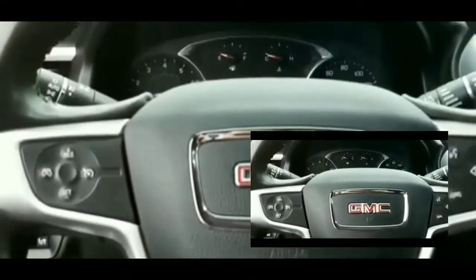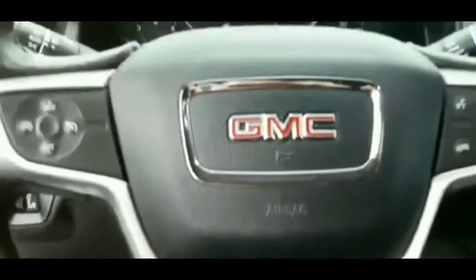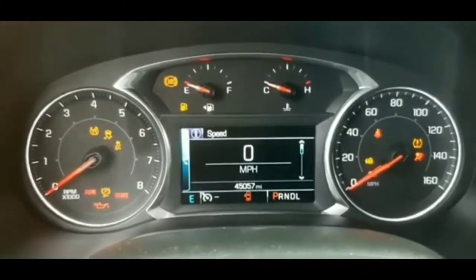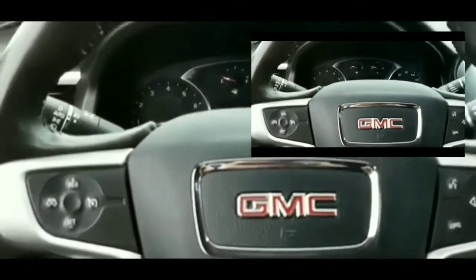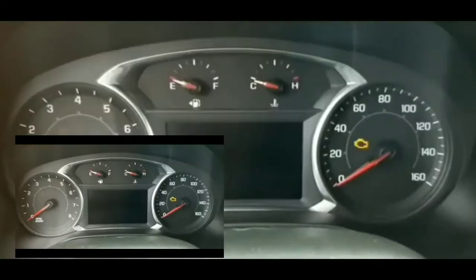So next up would be the relay on the car. The relays. So I'm thinking, could it be the relay? Could it not be the relay? Which is a good question, because the relay actually relays, that's what it does. It relays electricity from the battery to the starter itself. So if there's a disconnect on the relay, you're not going to get anything going to the starter.